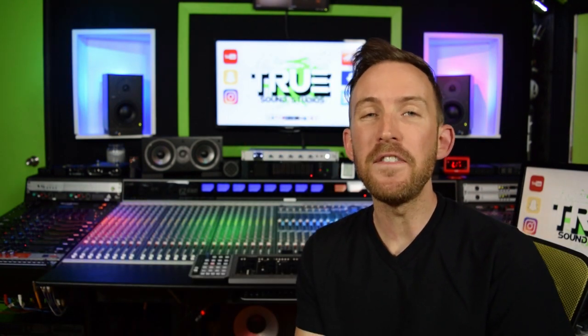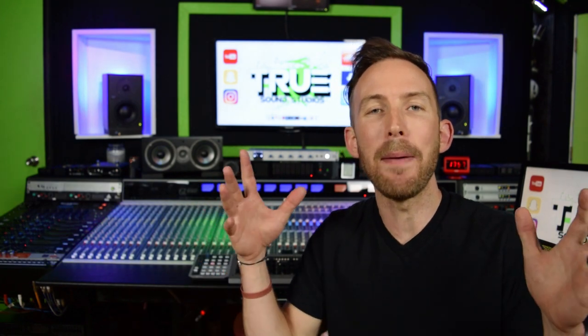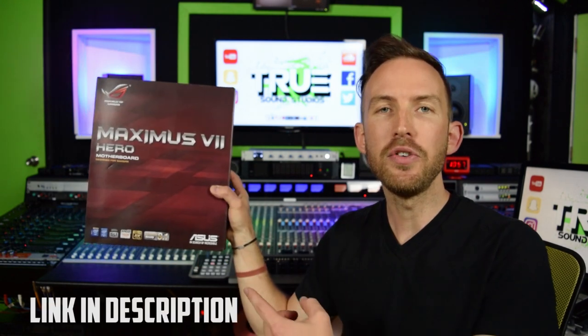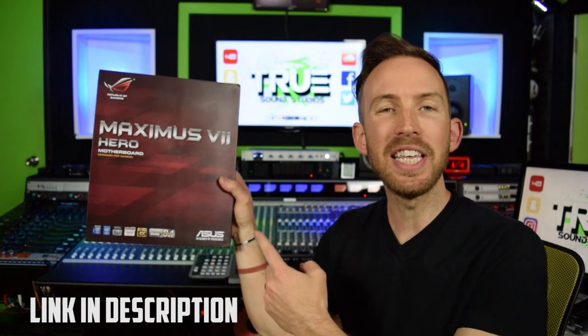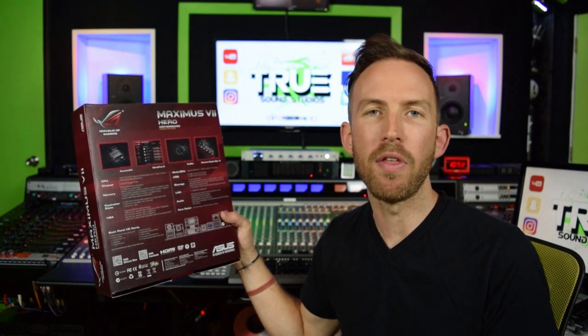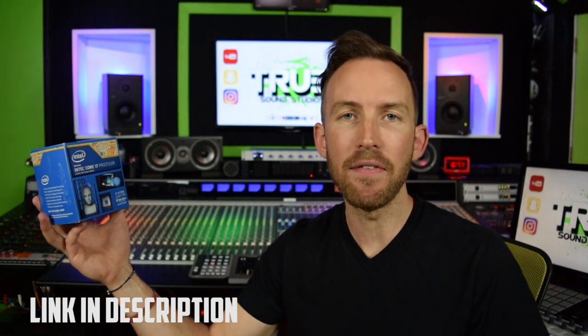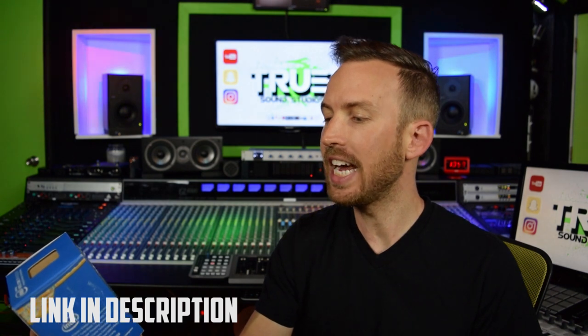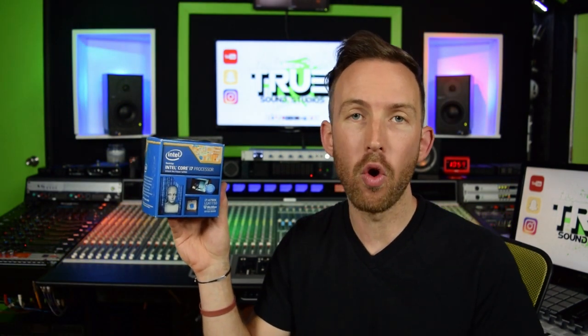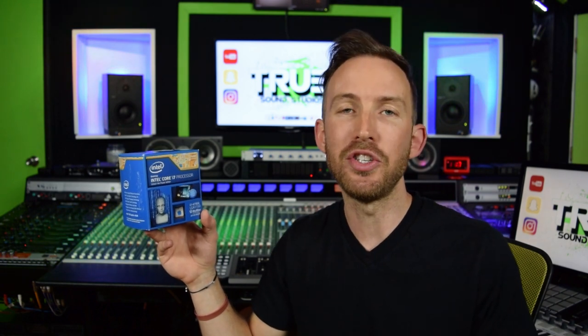I've been building my own computers for about 15 years now, so I have a pretty good idea of how to choose parts and components that are going to work together to give me not only a powerful computer but one that does what I want. I chose the Asus Maximus 7 Hero motherboard — it's 4K ready and can run Windows 8. It's technically a gaming motherboard, but a gaming motherboard is really nothing more than a high-performance motherboard. To give it processing power, I got the Intel i7-4790K, a quad-core processor that shows up as eight cores in Cakewalk Sonar Platinum due to hyper-threading. Even running sometimes up to 200 plugins per project, this processor still hasn't hit 100% processing power.